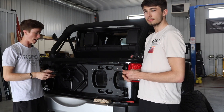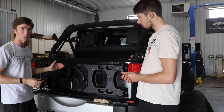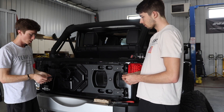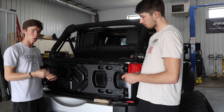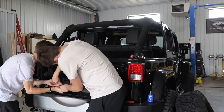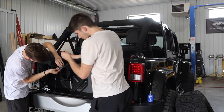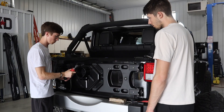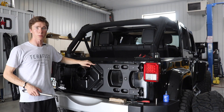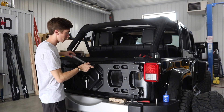On the other side of the tire carrier, there is going to be a little bit of a gap because the hinge reinforcement does take up a little space. The nice thing about this kit is it comes with two extra brackets. We're going to use a rubber gasket in between the tailgate and the bracket to prevent scratching. After these bolts are loosely tightened down, I'm going to torque them down to 15 foot-pounds as well.